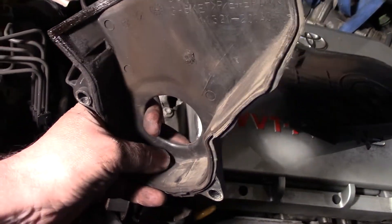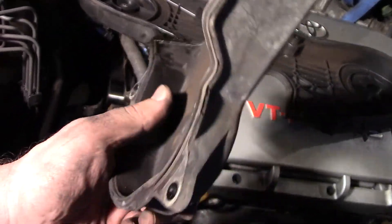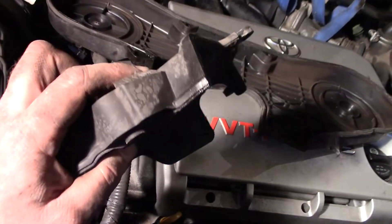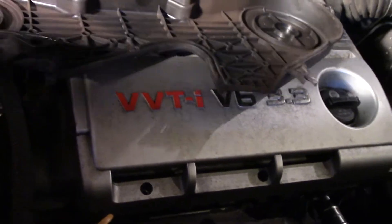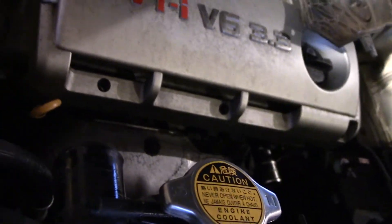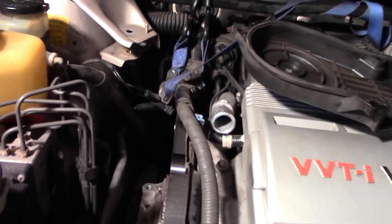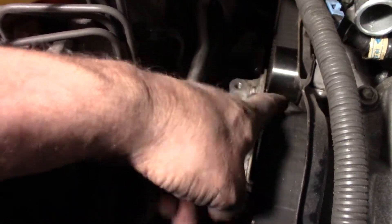Here's a good sign — there's no oil in the lower cover, only just belt material. This oil here is just road grime that got into the cover a little bit. You can see there's nothing from the top cams. I am not seeing any oil on the belt at all. The belt looks really good. I'm surprised because this is a 10-year, 100,000-mile belt — a Gates belt made in the USA.